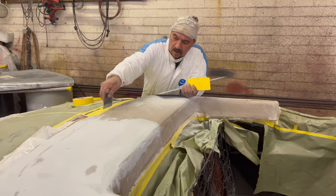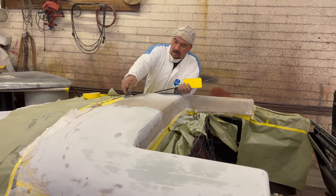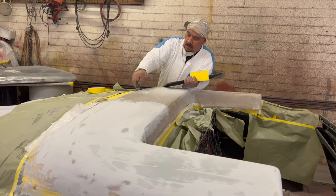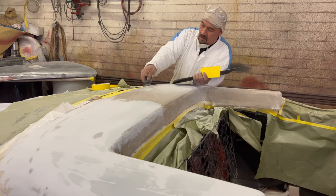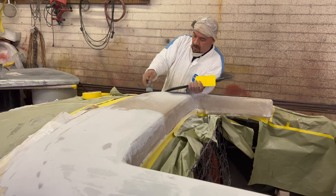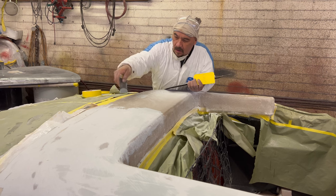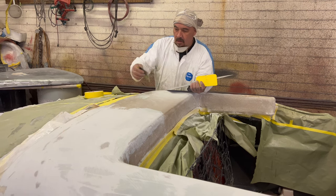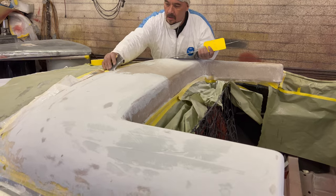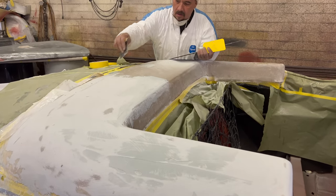What's Oscar actually doing right there? So Oscar has started out by taping the car — the back of the car in the adjacent area — with clear packing tape, because our stuff will stay put on the packing tape without affecting the paint on the car. We have a painted car, so we can't repaint it as a product of this. We want to protect that paint job, so we put the clear masking tape over the entire car in the immediate area.